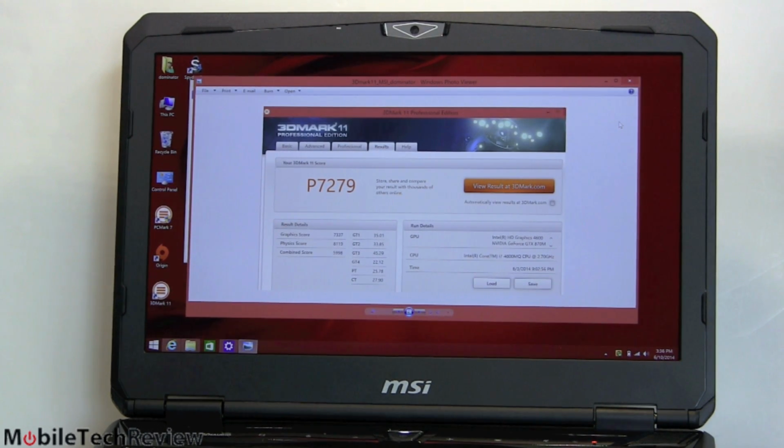Core i5, Core i7, when you're talking about a full mobile CPU like this quad core right here versus an Ultrabook CPU, there's a huge difference in computational performance. Geekbench 3, likewise, the numbers are very high. That looks largely at your CPU performance. 3445 for single core test, 12,835 for the multi-core test. So it holds up well.